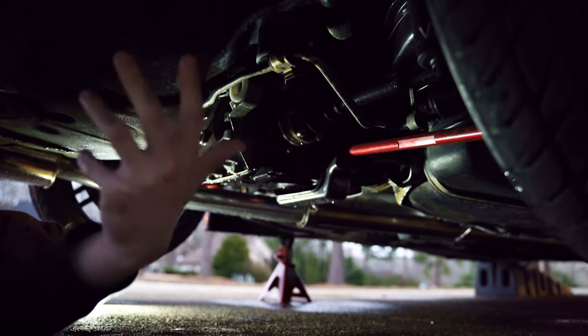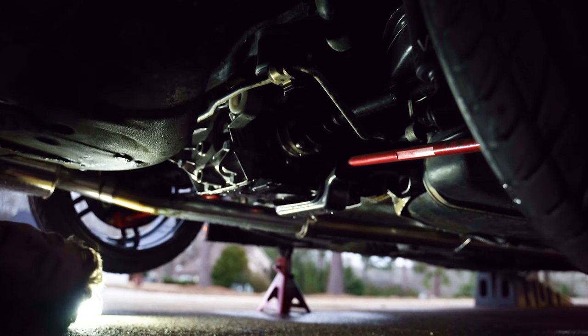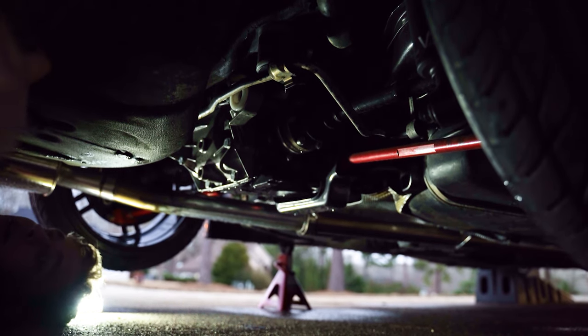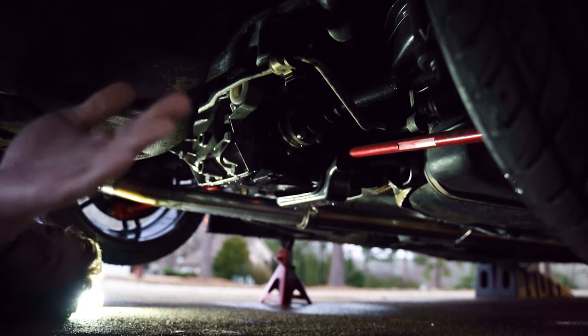In order to have camber in an E36, your entire trailing arm has to tilt with the hub because it is the hub. So you have to have mono ball bearings there. I don't care what anybody says. There's no excuse to have anything else there unless you run zero camber. If you run zero camber, then whatever, get poly. But you have to have a bearing there.